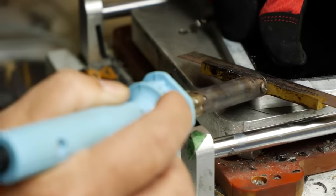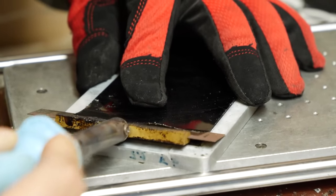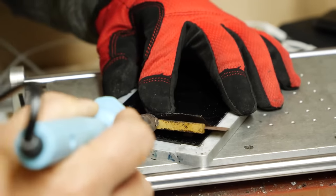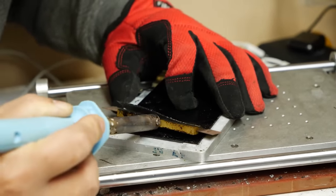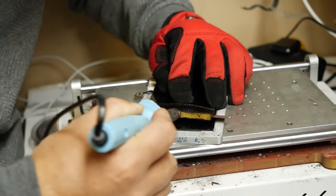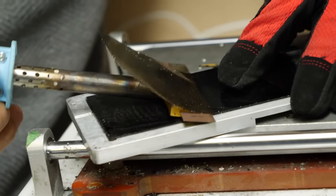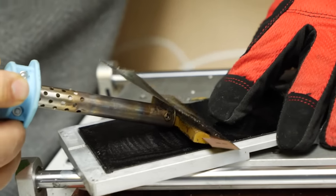Now it's time to remove the polarizer. Normally if this was intact they would keep it on, but for this experiment we need to take it off. This is one of the most satisfying parts of this procedure. Scraping it slowly from left to right, you can see that it just peels up fairly easily. Once again, this is extremely fragile — any mistakes result in a broken LCD and the process has to be restarted. The blade also heats up to soften up the adhesive. When you have the right tools, any job can be easy.